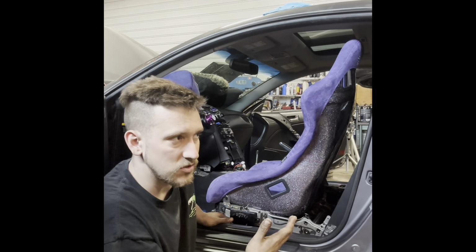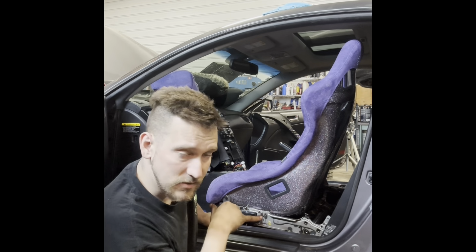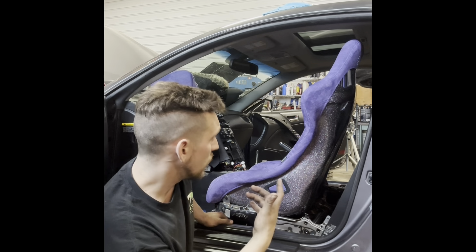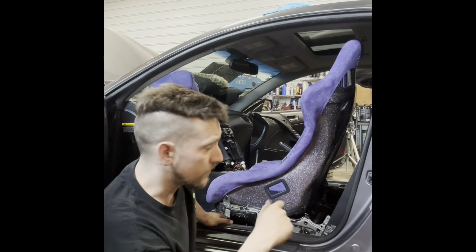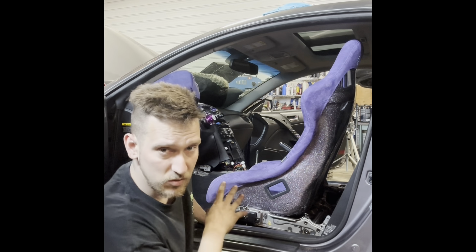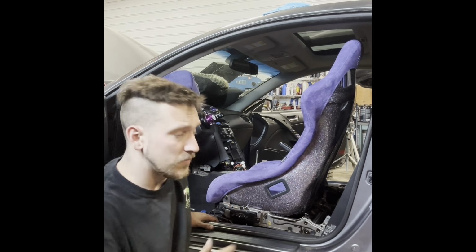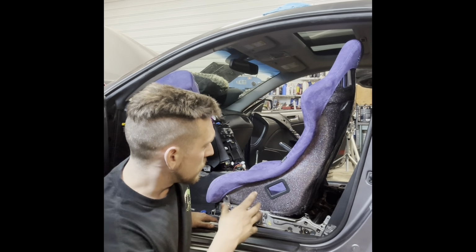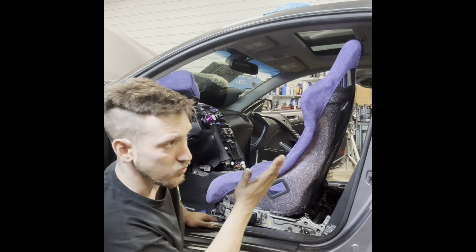And that's one thing about racing seats, you can't get a tilt out of it because they're solid back. But with something like this, you can tilt it because I left the base. So making it work like this, in my eyes, makes more sense. Now the passenger side doesn't really matter. Of course, we want to bring it up to a decent height, but also think about somebody that is a little bit taller. Now these are extra large seats, so they're kind of big for her anyway, but she's gonna be fine. Once the pillow is in there, it's gonna kick her up. But this seat, I've already tested, goes all the way up. So you can see I welded an L bracket here. Now my biggest concern is this was a two-piece system bracketry. So this whole bottom base, I have to make sure is strong to withstand the person's weight going tilted and everything.